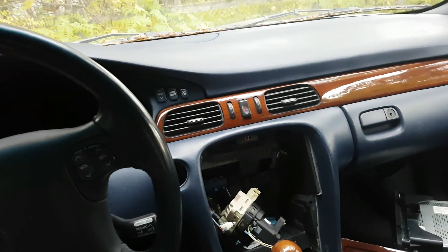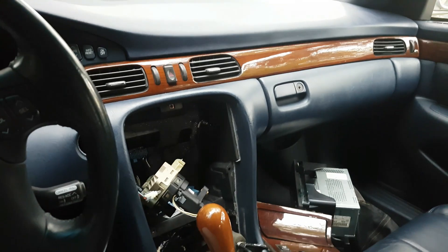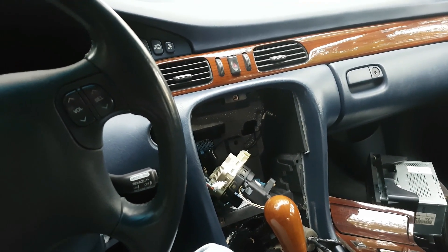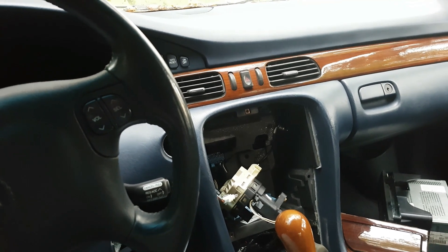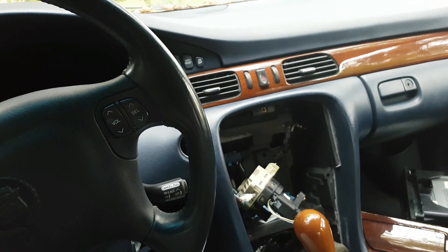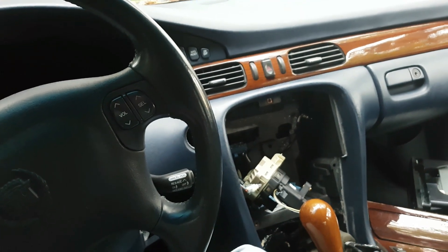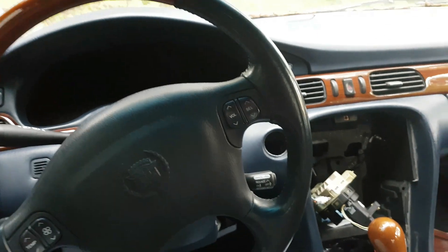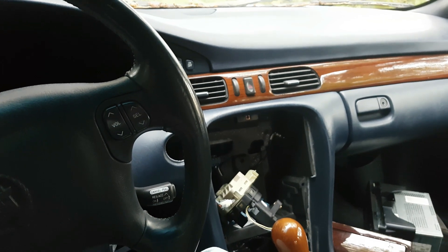This is an STS. I've had the same problem with this car before about seven or eight years ago. I'm going out on a limb assuming it's the same issue again. Back then the car started to randomly die on me — it would just quit going down the road, the gauges would go crazy, it would start back up, the needles on the dash would go weird, lights would come on, and it was throwing every single code it could possibly throw. I did some research and determined it was probably the ignition switch. I bought one, put it in, and it fixed every issue.